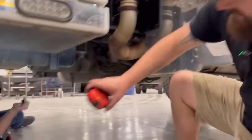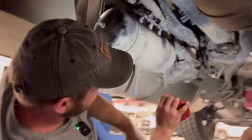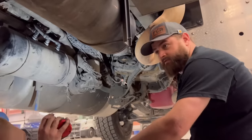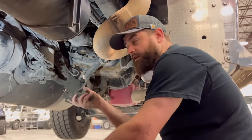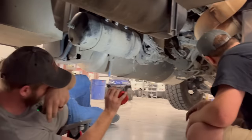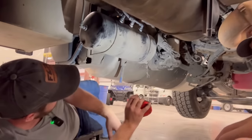Checking the u-joints — being as heavy as this thing is, I'd probably need to pull it out to check them properly. The big thing we need to fix is the clutch for sure. When I drove it, it was terrible — it's right on top. It's got like a quarter inch of free play, which is better than nothing but won't hold anything. We might be able to pull the cover off and inspect it, but we'll probably have to put a clutch in it.